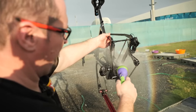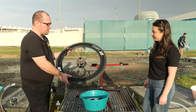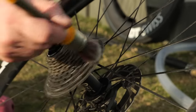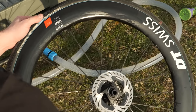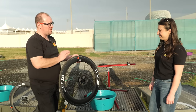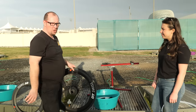You've rinsed the bike off and now we're onto the wheels — I can actually see some dirt on the wheels. What are the top tips for washing the wheels? We're going to do the same sort of thing — degrease it first, because as we wash the degreaser off it's going to go on the rim and you don't want to be doing the job three times. So we'll degrease the cassette. Top tip: degrease both sides of the rim to help the oil run off the wheel as well. Then put some degreaser on the hub because the hub gets missed quite often. This is where the brush is really helpful — we've got a couple of small brush options you can use.